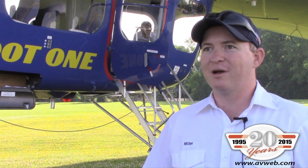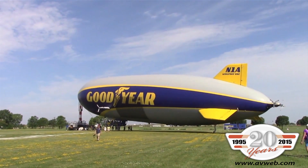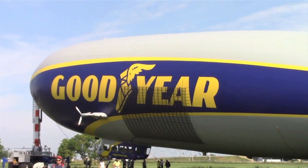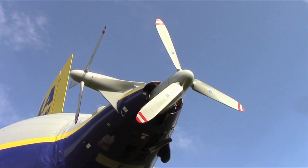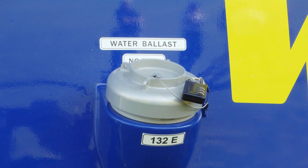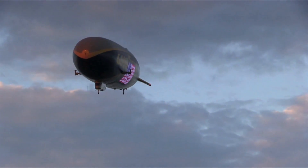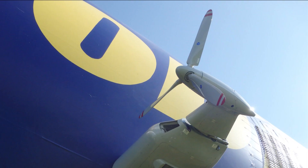It's larger than our older aircraft — just shy of 250 feet long, right around 300,000 cubic feet of helium, and it also has three engines compared to two. We have a tail engine on the rear with a lateral fan and also a fan that can push or rotate down to help provide pitch. The engines on the side of the aircraft can vector 120 degrees, so essentially on the ground we operate a lot like a helicopter.